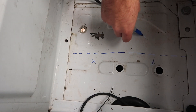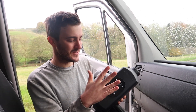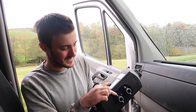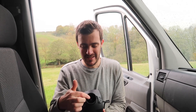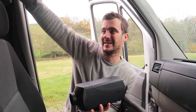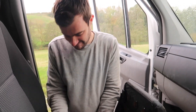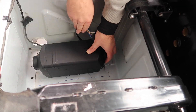Not this area, not this area but this area. So now we'll be drilling seven holes through the floor. The outer four are just studs and then on the underneath we'll put a nut on it to squeeze it against the van. This one here closest to the fuel inlet is the intake, so air will be sucked in from underneath the van. Diesel will also be pumped in through this one, it'll burn and then come out the exhaust into the muffler and then outside the van. This is the inlet of the heater — it will be sucking cold air from inside your van, heating it up and then blowing it out. So we're going to be mounting it this way so the heat gets blown down into the van. We'll put this gasket down a little bit and then put it in place on where it looks good in this area.